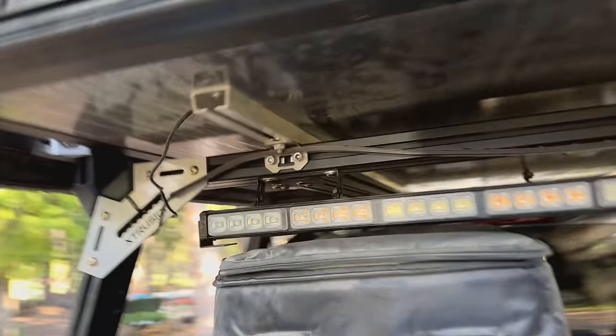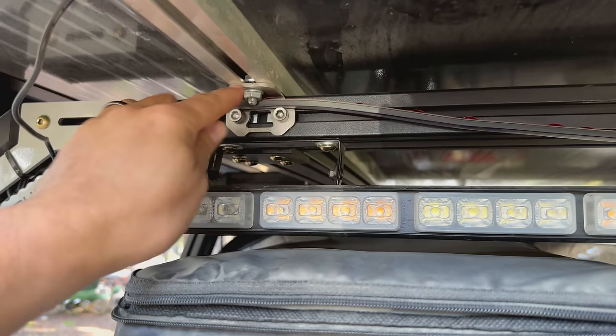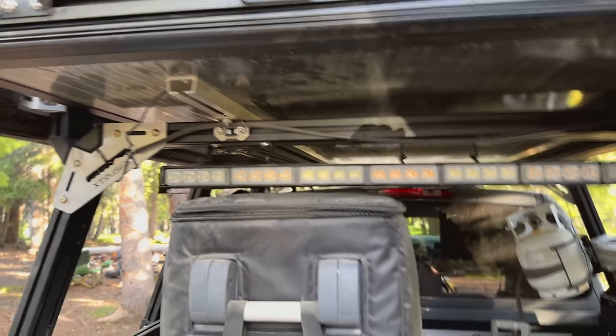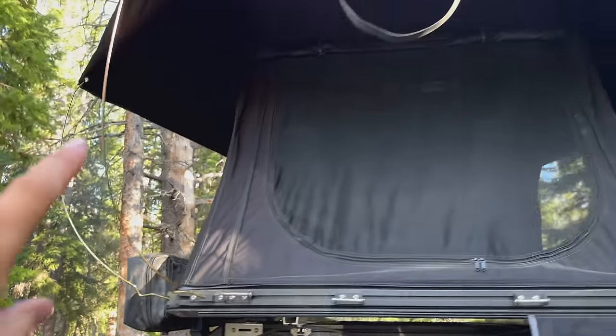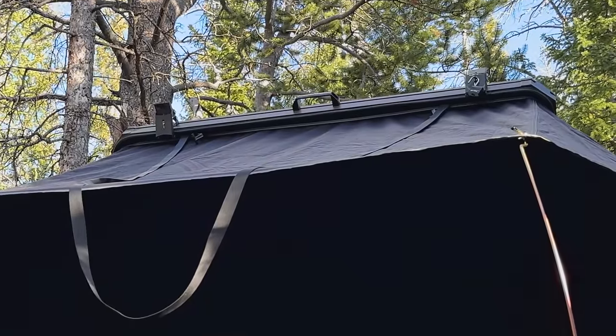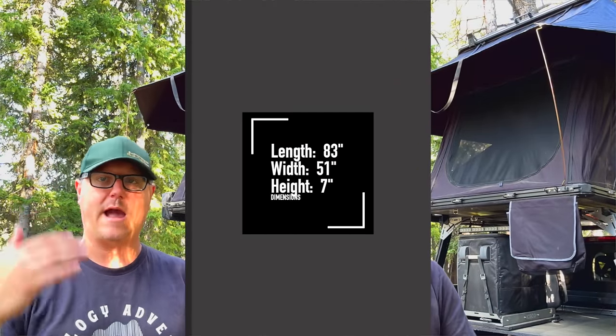As far as mounting the tent goes, it's actually really easy and very standard for most of these tents. It has a pair of aluminum rails underneath. With my bed rack, it's extrusion-based, so there is a rooftop tent mounting kit, but I used the stock stuff that came with it and just mounted it through there. It comes with a set of U-bolts — four U-bolts — and you could mount this to pretty much anything: drop them down, connect the bottom nuts, cinch them up until they're tight, and you've got your rooftop tent mounted. You can also see this piece of elastic, which is what you put up when you bring your awning down to hold all the fabric in and make it easier to close the rooftop tent. The dimensions: it's about seven feet long, about four feet across, and when it's closed up it's a little under eight inches tall. So it's a really slim profile and looks really nice on the truck.